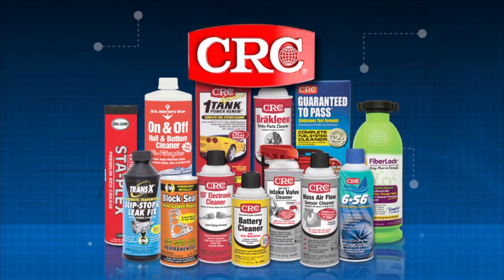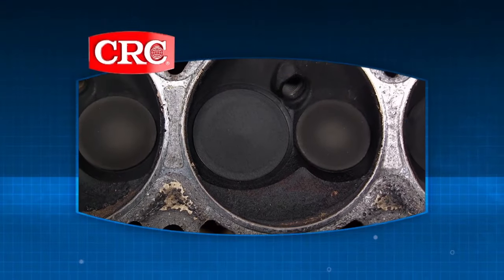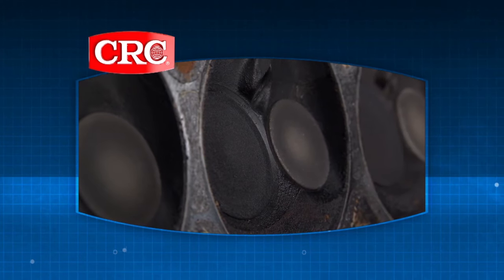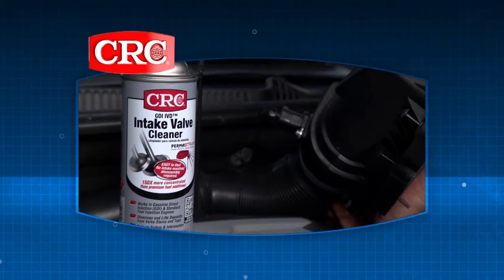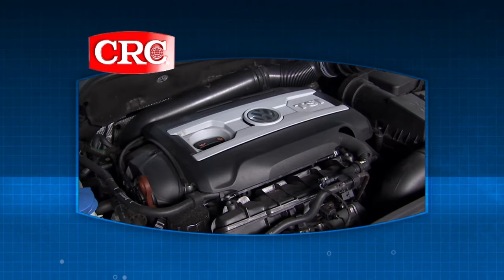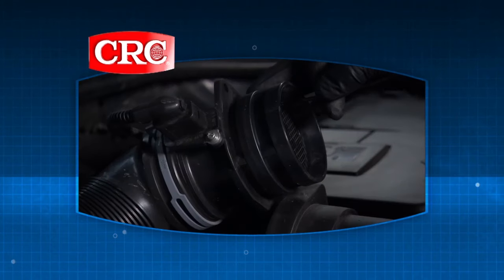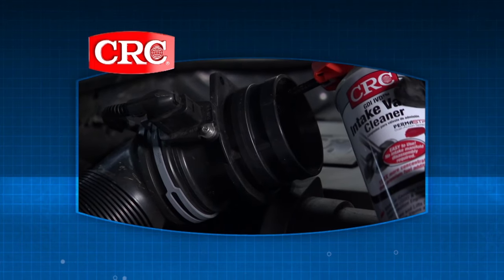What is the easiest way to clean the intake valves on my GDI engine? Engine intake valves are prone to deposit buildup because they never get washed with fuel. There's an easy way to clean your GDI intake valves without having to disassemble the top of the engine: CRC GDI IVD Intake Valve Cleaner. To use it, start the engine and get it to operating temperature. Locate the mass airflow sensor and use the attached Perma-Straw to insert the product past the MAF sensor directly into the air intake. This will avoid throwing any engine codes.